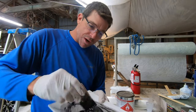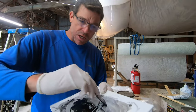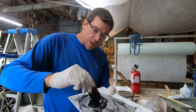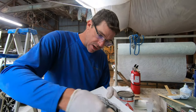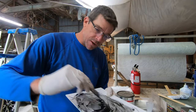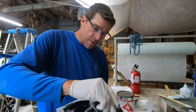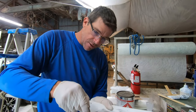And a mold, when you spray it in, one surface is waxed and the other surface is exposed. And then most of the time you're going to be coming back on that exposed gel coat and laminating fiberglass. And you want it to remain tacky so that it sticks. But when you're doing patches or repairs, it's kind of different. So you're using gel coat in a way that it wasn't necessarily originally intended to be used. And that's why you have the additives like the modifier C, and there's other things you can use.